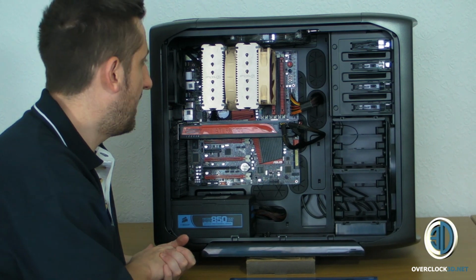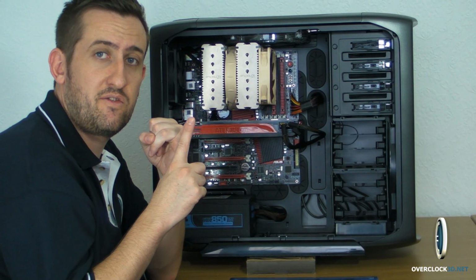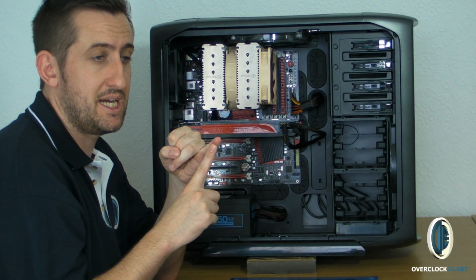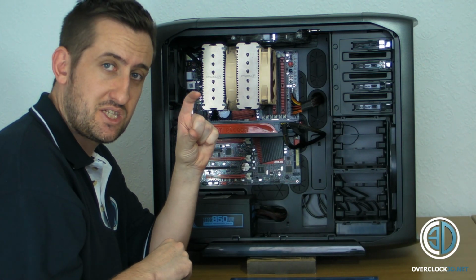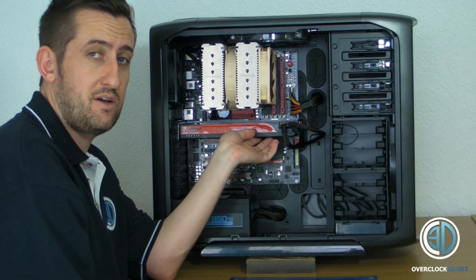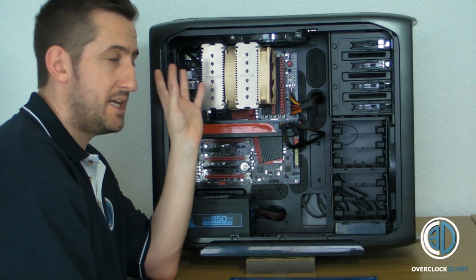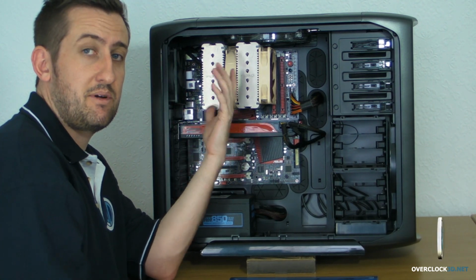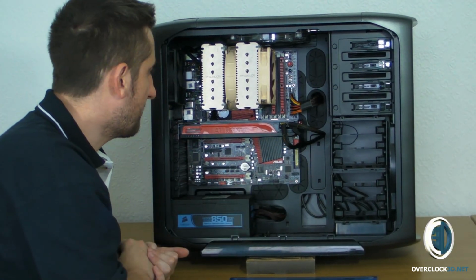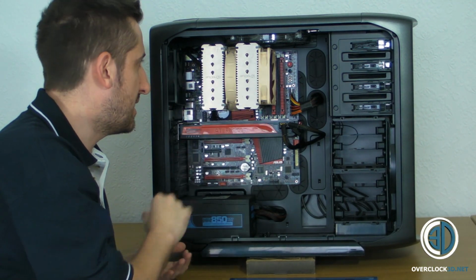For a Corsair case to struggle in having a 240mm radiator in the roof, and bearing in mind a 240mm radiator that's 50mm thick on an overclocked 480, the card will still hit 75 to 80 degrees on load. So, do you know what I mean? With that 240, you're still going to need a massive CPU cooler anyway, and you're not going to be able to have room. So it really doesn't work. There's just not enough room there. The case needed to be a little bit taller to be able to have it all in there.